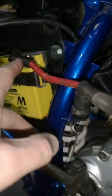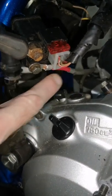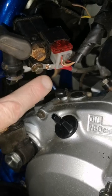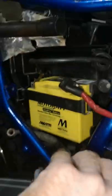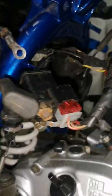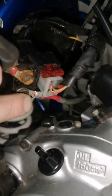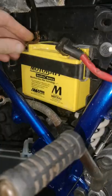I've just charged the battery up. I've put that red here up to the battery. And I put the ring terminal on there. The starter motor off the Gilera, and that's under there. Right, when I got it, this one was joined to the battery, and the black earth, there's the earth comes off this, it's that one there. That earth was earthed onto this side. But I think it should work now. Yeah, fan there. Make sure that's rigged up.